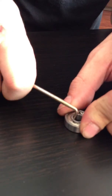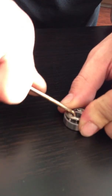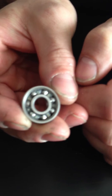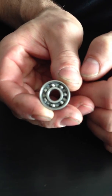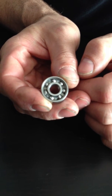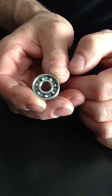These are a little bit more robust than the last ones I got. That'll pull them out. As you can see, they're totally packed with grease — and that's because these are non-service bearings. They're meant to be put into a machine, run at thousands of RPM for a really long period of time, and when they wear out you throw them away and replace them.